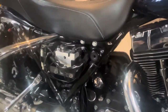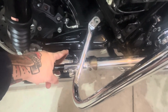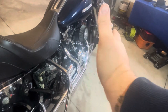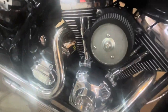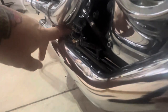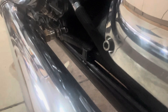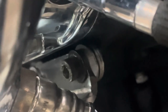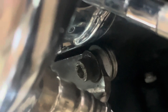These four-and-a-half-inch Bam Sticks go on as the slip-ons. You can see I've got some space now between the swing arm and the pipe. To make that happen, not only did I adjust the header out so it moves over a little bit, I also had to put spacers behind the mount — they're just washers — to bring it out about three-eighths of an inch.